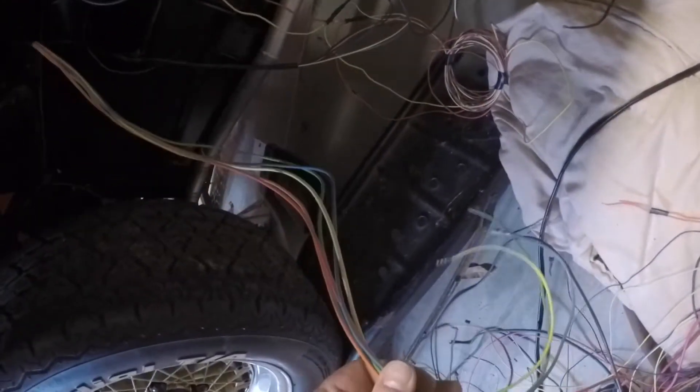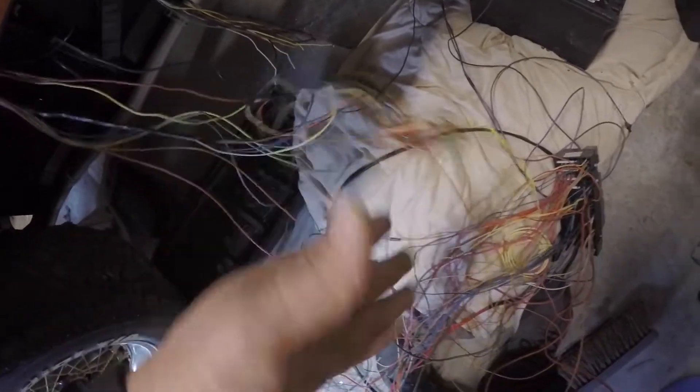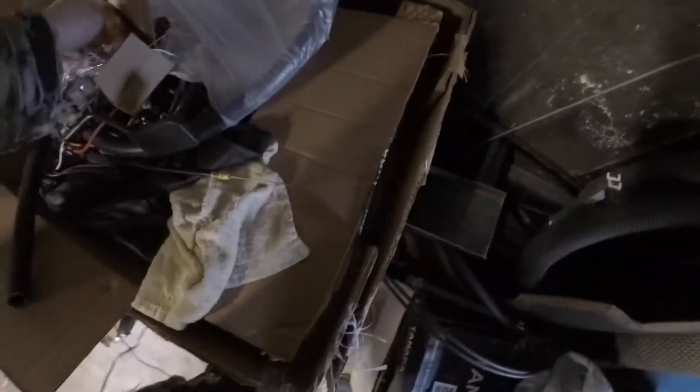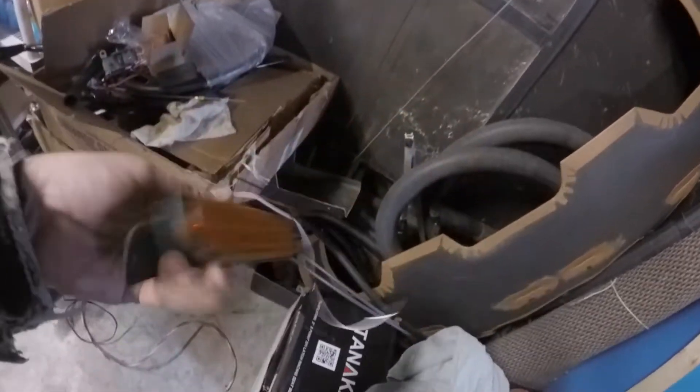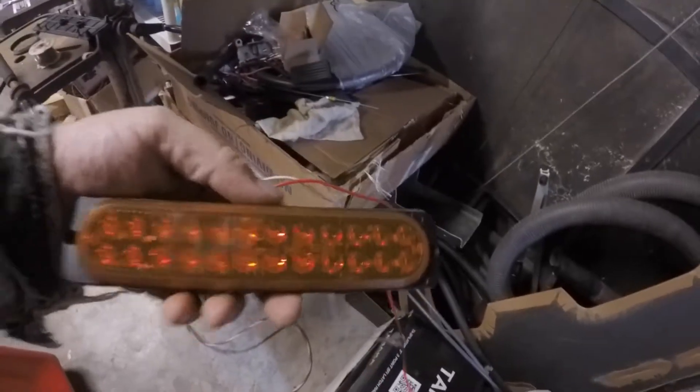It's for the wiper switch, which needs a special parking setup because it's an old Triumph Lucas system. These are the turn signals — I've gotten these bundled up so the rears blink, but the fronts don't yet because they're not installed. I did receive the front signals in the mail. These are LED flashers up front — high and low, ground white for running lights, red for blinker — so I'm going to attach these to the front for now until I redo the headlight buckets.